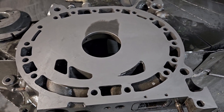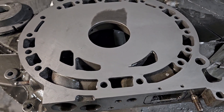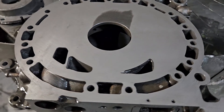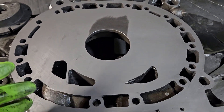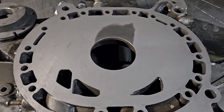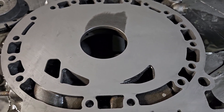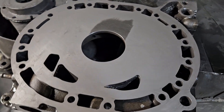Not everybody has the luxury of buying a brand new side plate, so in a lot of cases lapping and resurfacing — which is a factory-recommended service — is the way to go. That can give you a full second life, like new, for your components. When rebuilding a motor, if you're just putting parts back in as used, it's hard to tell if the housing is perfectly flat, especially if you don't know the history — whether it's been overheated, damaged from a blow-up, or over-rev. These are all reasons you may need to send a side plate out for lapping.